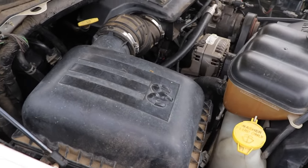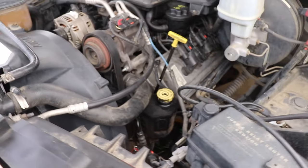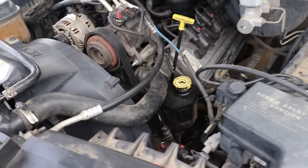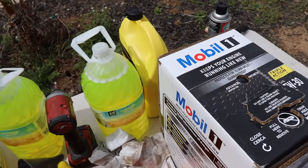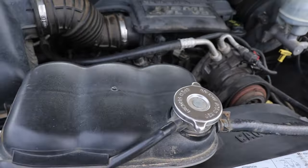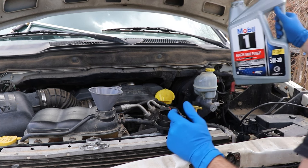Anthony's been busy working. He's got all the parts back on. While I was underneath doing all the transmission housing bolts, he got all the accessories back on — the belts, the fan, the expansion tank, air box. Next up is let's get these fluids in. We got coolant pre-mixed with distilled water and we got our oil. Let's get some fluids in and get ready to fire this bad boy up. This thing holds like four and a half gallons of coolant, so make sure you stock up. And this guy holds seven quarts of oil.